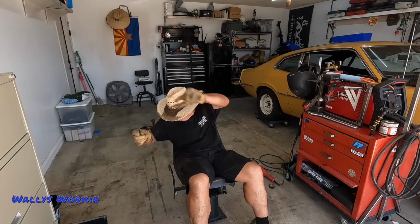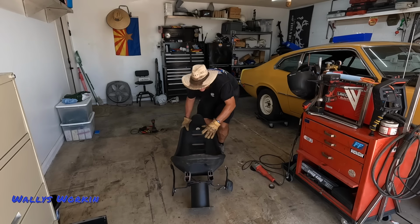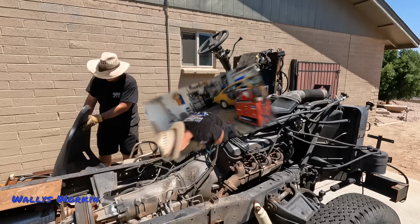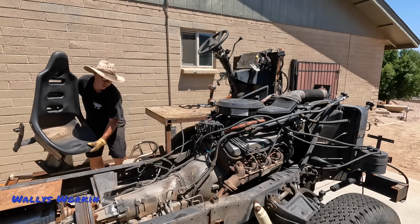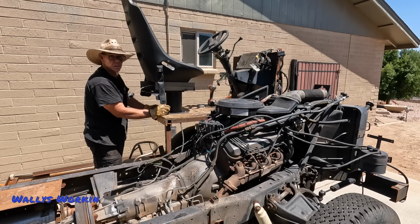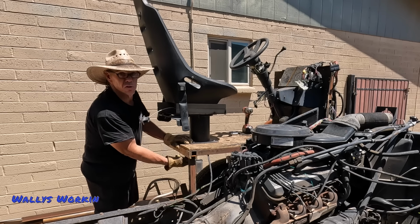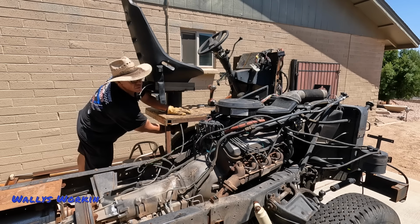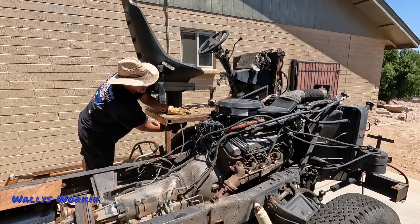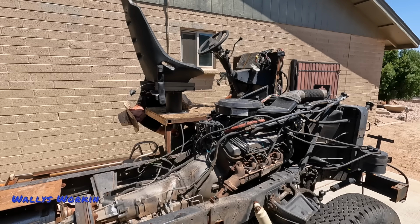All right, cool. Oh shit, oh shit. All right, I can't lean on it like that. Dumb ways to die. Right. Of course, it's like 110 out and I'm doing this stuff. So if you ever wondered how your seat bases are bolted to your motorhome floors, cheap base through plywood and drilled straight through square tubing, and there's nothing backing it up. There's no sleeves inside the square tubing. It just crushes as they tighten it. So yeah, that's pretty much how your seat's mounted.